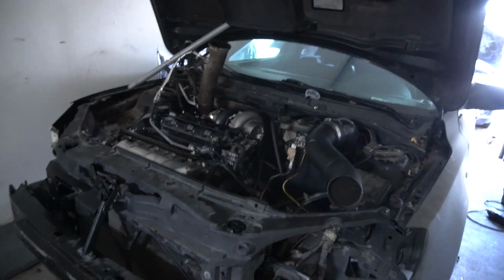So I was saying that they're more expensive because the MazdaSpeed6 is all-wheel drive, as you guys know. So it has a rear diff, it has a transfer case, rear axles, and a drive shaft. Those are all the extra things that the MazdaSpeed3 doesn't have because it's front wheel drive. So the expense obviously is those parts if they break.